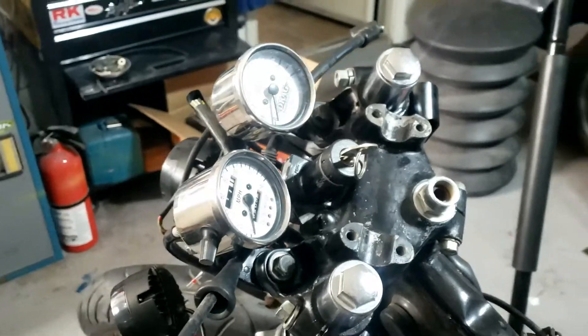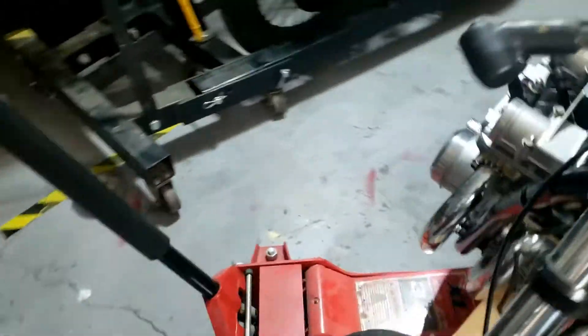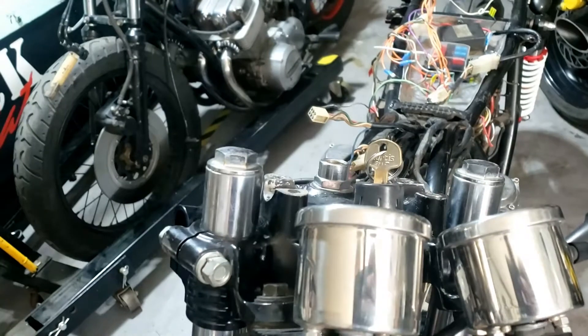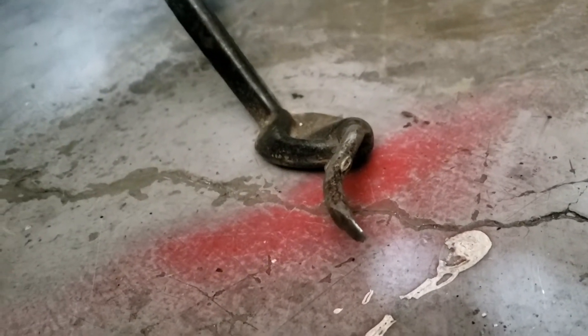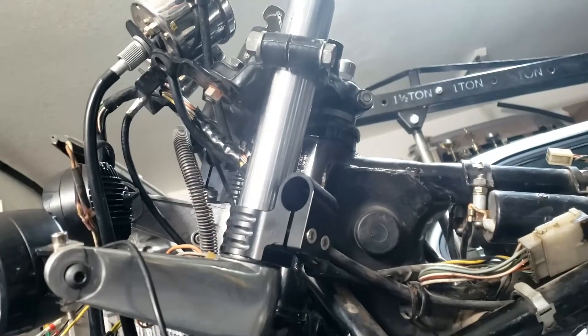It took me a while to work out — I wanted to raise these out of the yoke and I forgot to loosen them at the bottom yoke. Duh. And of course when I did, the whole thing collapsed and fell over — actually a big accident, wife came running, I'm fine. Now we've got it precariously balanced on a jack so I can bash them down against the front wheel off the ground a little. I can decide what I want up here — what looks sensible. That's starting to look sensible. Also dropping the front end — I know I could cut the forks and do all that stuff. Both sides set at 38 millimeters, which apparently is a very popular size in the US. This thing has to go — I just spiked myself in the knee. Bloody stupid kickstand.